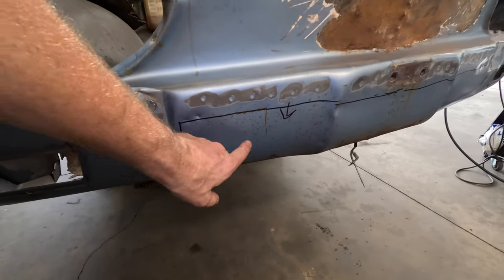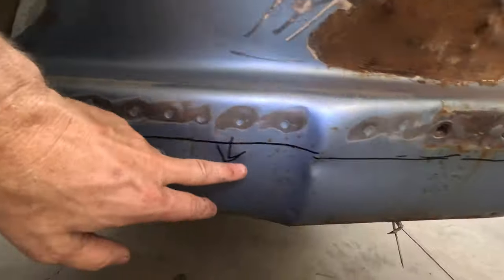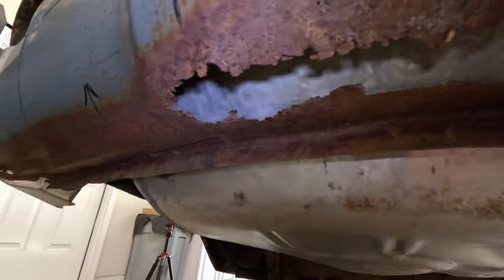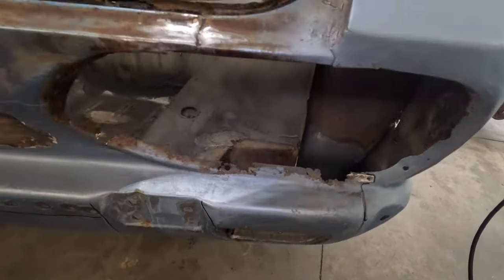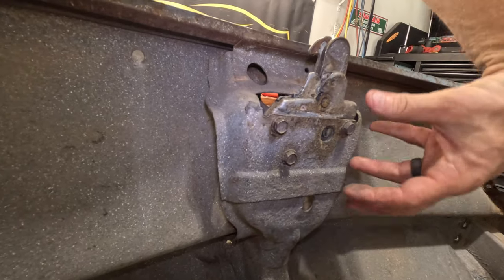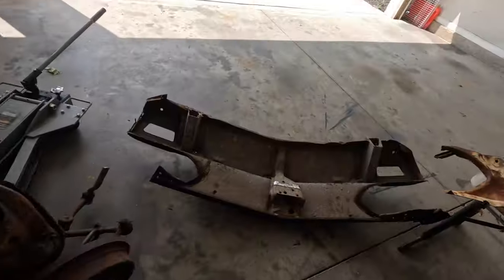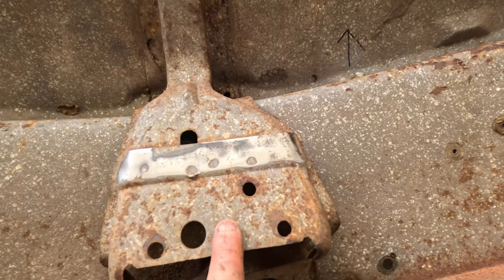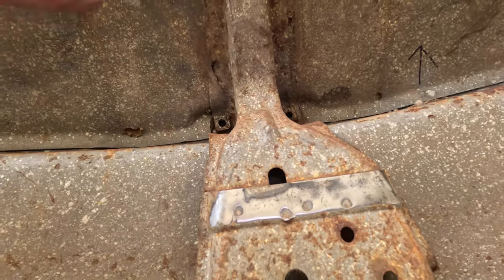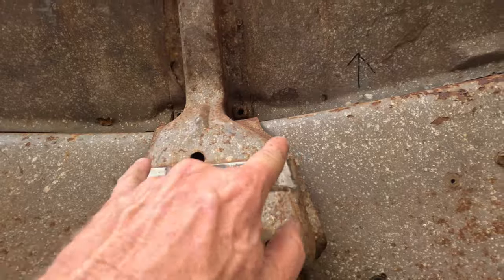I've decided I'm going to go ahead and cut this out. I roughly marked this section where the frame horns are — I'm just going to cut around that and cut out this entire piece in one fell swoop, then cut from here all the way to the factory body seam on this side. On the inside, the hood latch mount is spot-welded. Looking at the new piece, it's just got four spot welds. As long as I drill those spot welds off, this part can stay with the new piece and this part will stay with the old structure. That way I don't have to try to drill out all these spot welds and line everything up. Let's get out the death wheel and start cutting out the front bumper.